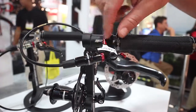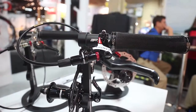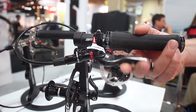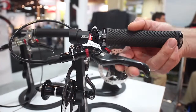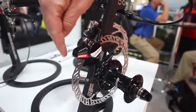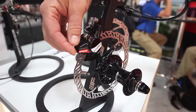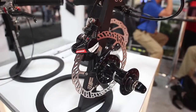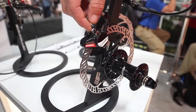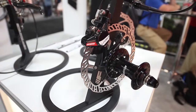We're shooting this body out of magnesium, which makes it extremely lightweight as opposed to an aluminum body. And of course you've got to have the carbon fiber lever blade — the contact point. It's nice, it keeps your fingers warm when it's cold. Going down to the caliper end, we've got a one-piece forged monoblock caliper, lightweight again. Big arch back here for stiffness to control the thing. Inside we've got aluminum-backed plates with a semi-met pad. The aluminum backing plates save you about 12 grams — it doesn't sound like a lot, but when you're chasing grams, it's a big deal.